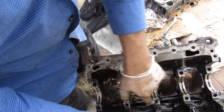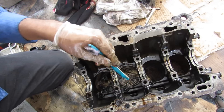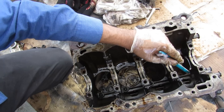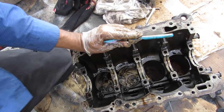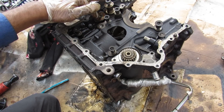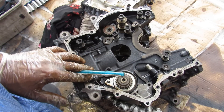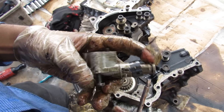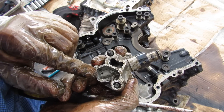Looking down inside the block you can see the balance shaft inside and rotating. There are two balance shafts — one on each side of the engine, with one side being where the turbocharger bolts up. The main oil gallery runs from one side all the way to the other, fed by the oil filter, and lubricates the main bearings. There are also oil sprayers inside the cylinders that spray oil on the cylinder walls for lubrication. At the front of the block is the timing chain area with the hole where the hydraulic chain tensioner sits.